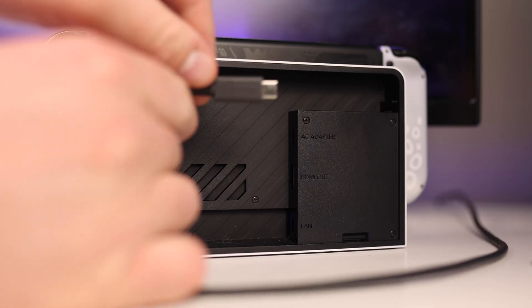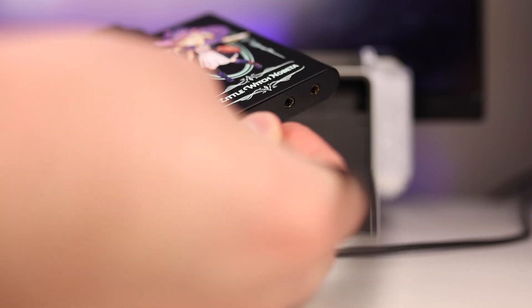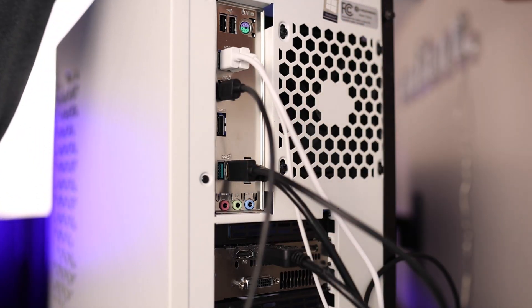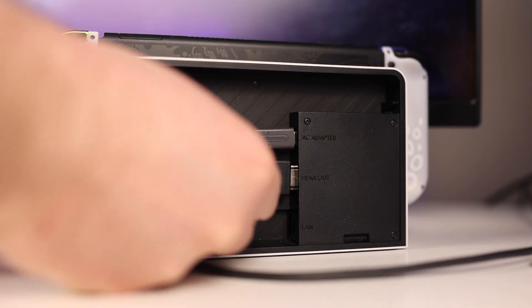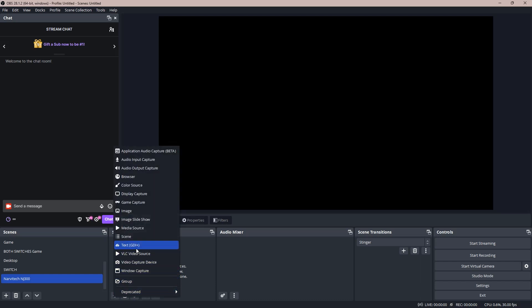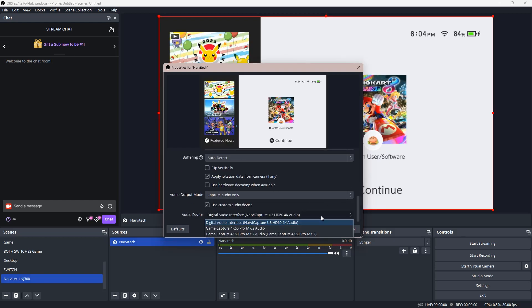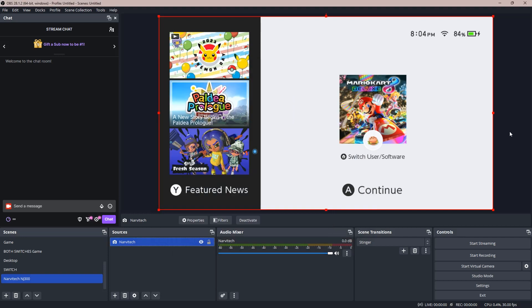On the other side you have a USB-C port and two aux cord ports. It's really awesome that they featured aux cord ports — I've never seen a capture card that has that, especially at this price. To get it running: make sure your console is plugged into power, take the USB-C to USB cord and plug it into the USB-C port on the capture card and run it to a USB-3 port on your computer, then plug the HDMI cord from your console into the HDMI in port on the capture card. That's literally all you have to do — no downloads, no installs other than OBS, just plug and play.